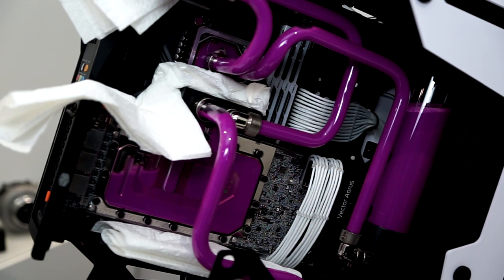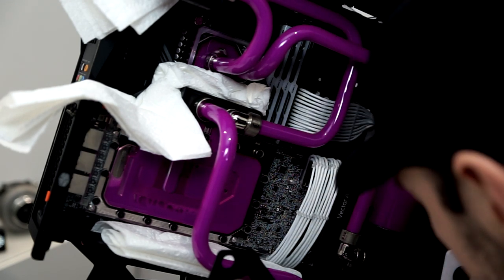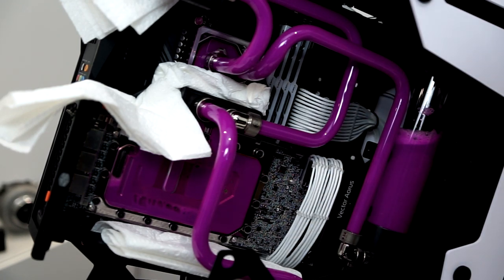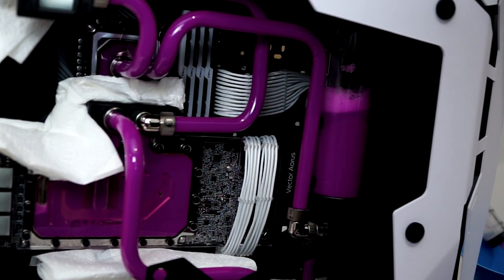Pump back on. This time we should have a complete loop — we shouldn't see the coolant come down too much. It is going to come down a bit throughout the next few hours as we bleed the system and air comes out. You can see a lot of air bubbles coming out, but I'm not seeing any leakage, which is the main thing. We'll top up the reservoir again as it falls down. Checking that there's no dye on any of the paper towels — it's good that we're using a coloured dye because any leaks we'll see very quickly. I'll tilt the case this way a bit as well to help the fluid come through.